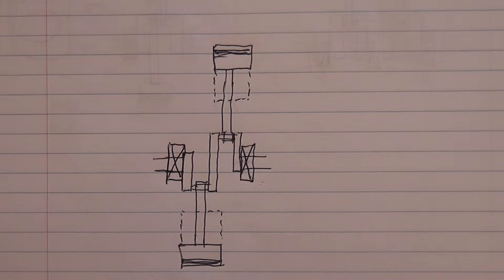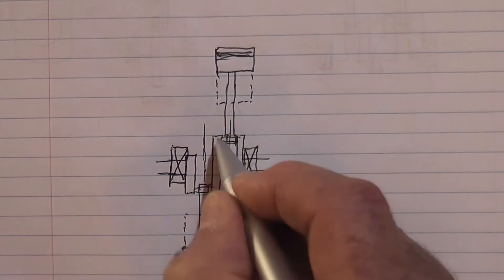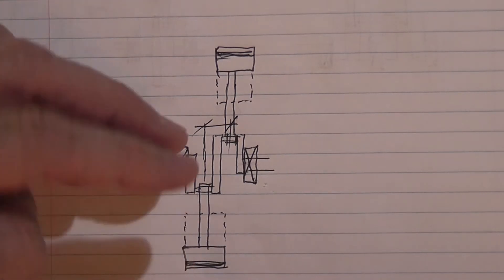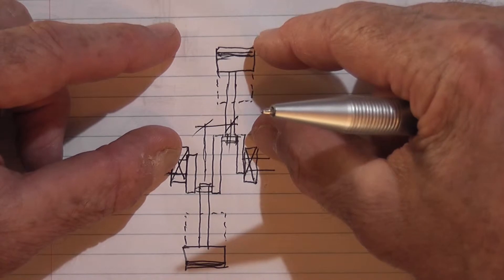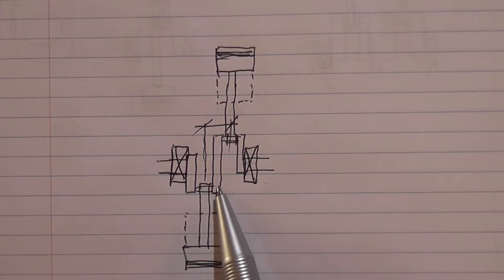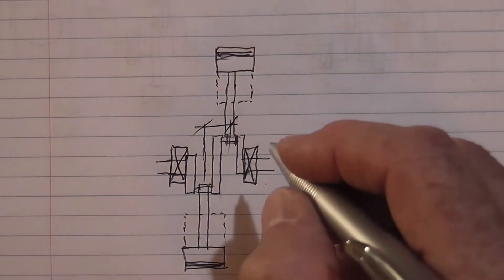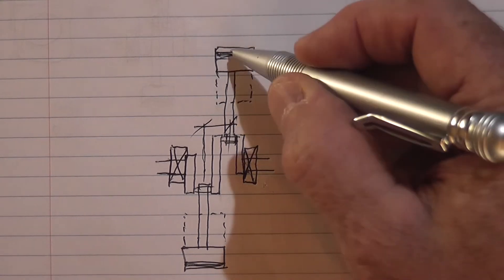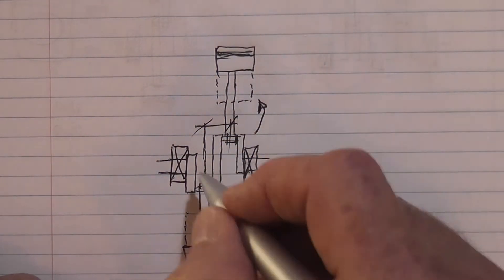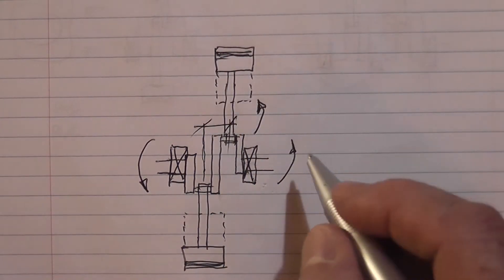It's much better than a 180-degree twin engine because the separation distance is very much closer than in the parallel twin arrangement. With a parallel twin, you've got to have the cylinders further apart because they are in the same plane. Here, because it's over to this side, we can bring the crank in and just have one web between, ending up with two main bearings quite close together. When the pistons both get to the top you end up with a couple, and when they get to the bottom it reverses.